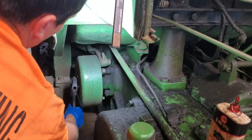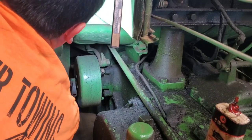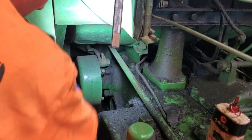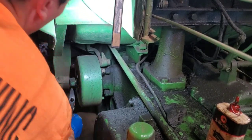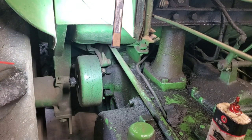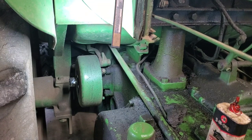It wasn't too tight on there. Now we've got our nut covered. Not a bad idea to hit that shaft with some PB Blaster or whatever penetrant you choose — get that worked in there a little bit. Now we're going to give her a couple of good swift smacks with the hammer and see if we can bust her loose.